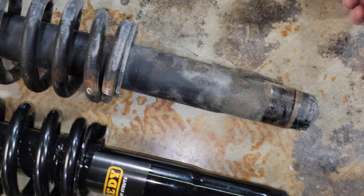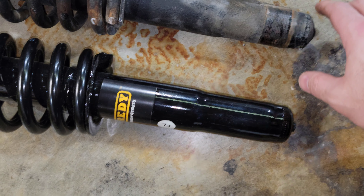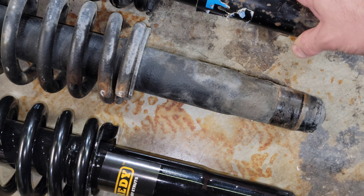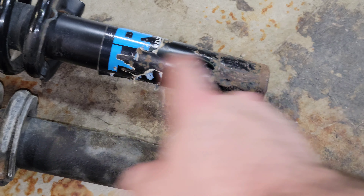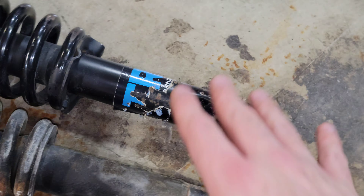You do have the little tabs there — you don't have the kind of rounded edge the way it is on the OEM strut and on the O-Ready strut. These have the tabs underneath too. If you're going with any type of aftermarket strut, you do want to look for the tabs. There are some that do not have those tabs, and I've seen people going off-road where the suspension fork has jammed way up the strut — that is not something you want.